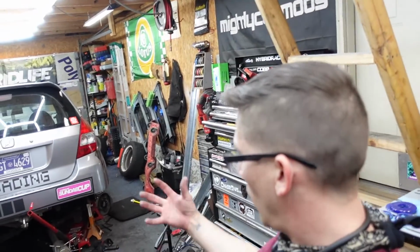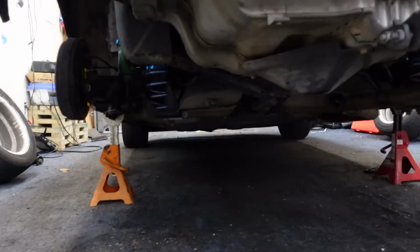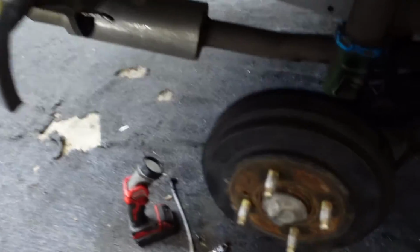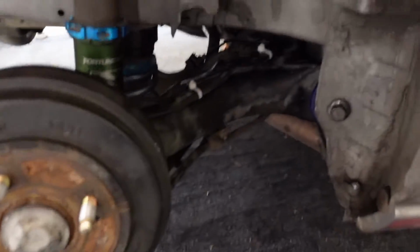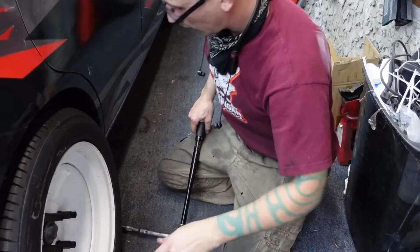That worked out. I'm not going to completely tighten those bolts yet until the car is at drive height for level. Then you torque those bolts down. Now I'm just gonna put everything back together. Hopefully it all goes smooth. Hey, everything's back in, all secured. The only thing that's left is I gotta rebleed the brakes, fun, and put the wheels back on, and then torque these guys.